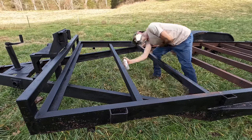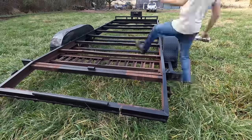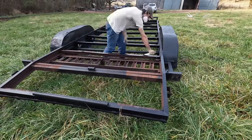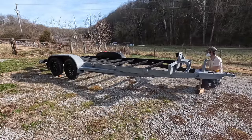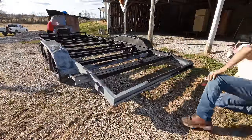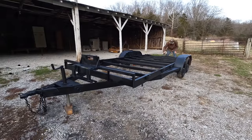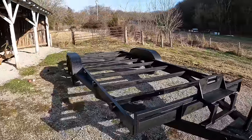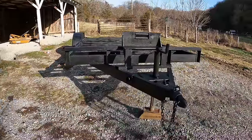It took me two and a half to three hours to paint the inside of the trailer. I did two coats of rust reformer and then three coats of high-performance enamel. The outside had been painted with a bed liner a couple years prior and was actually holding up pretty well, but I decided to redo it. I hit it with two coats of primer and then three cans of truck bed liner. After it dried, I used one more can of truck bed liner on all the high-use areas.